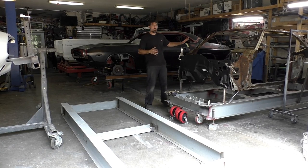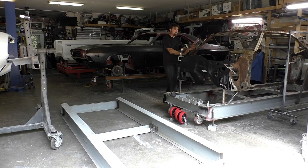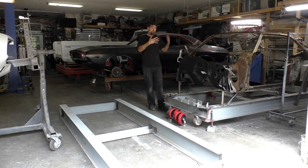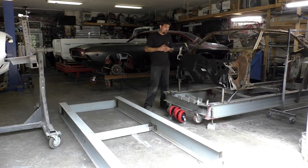At this point, there's nothing left in this car that if it wasn't for a frame jig, I could push in on this side of the car and fold the whole car. So getting it to its factory measurements where the window is going to fit and all the body panels is going to be really hard.